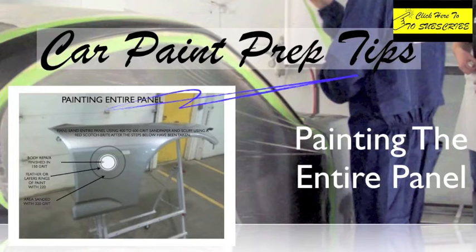If you're wet sanding, you can use 400 grit because it takes less effort. And again, you may check with your paint manufacturer to see what they recommend, but for the paints I use, 400 grit works real well. And the base coat covers that. You don't see any scratches through it. You can use up to 600, and 600 will achieve the same result, but it's just going to take a little bit more effort to get it there.